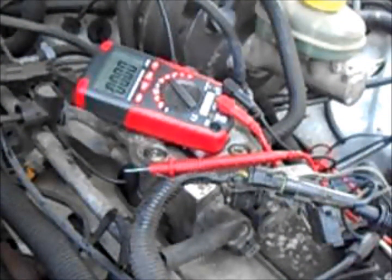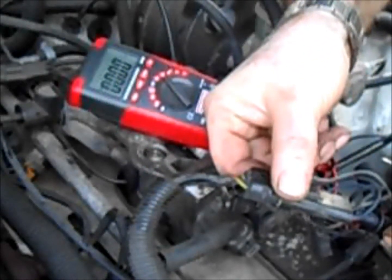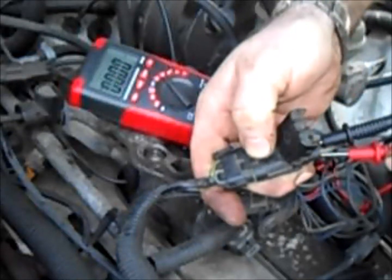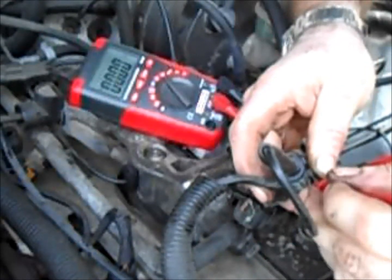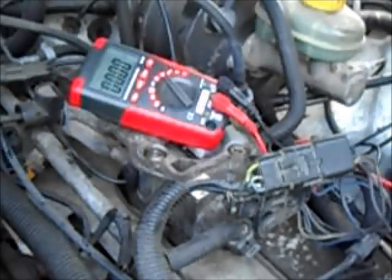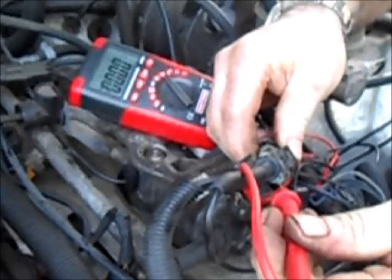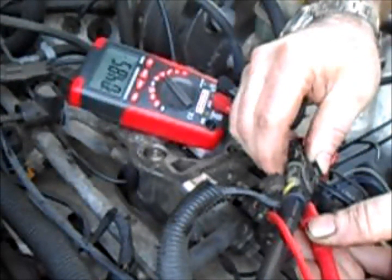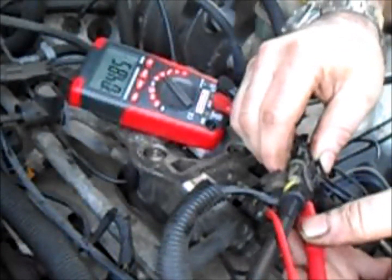And you want your battery hooked up. Okay, battery's hooked up, so then we're going to probe. We got the ground into ground, letter B, and now we're going to go into letter A. And I'm getting no base reading. Maybe we need the accessory on for this. There we go. So turn your key to the accessory so that you have power. So 4.85 is our base reading.